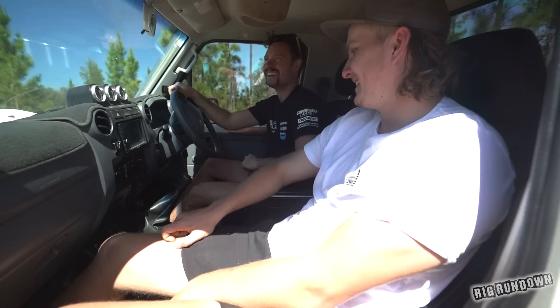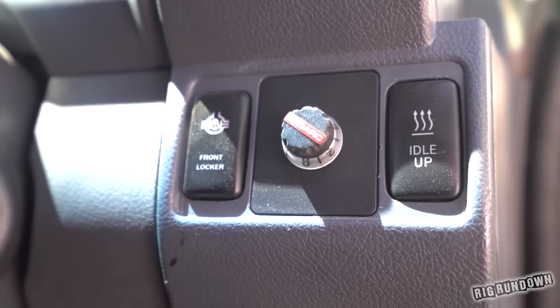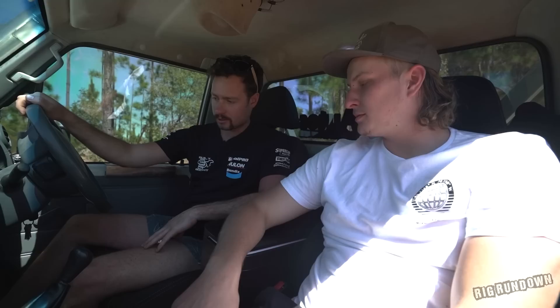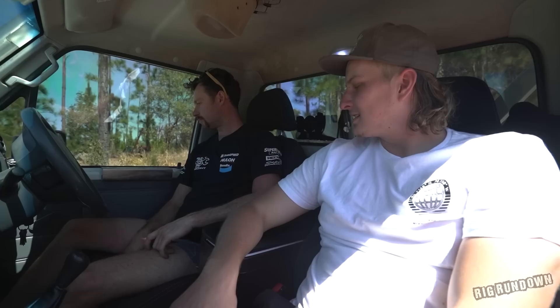There's no UHF radio in here yet — I'm waiting for a new one to come. You've done the whole Cape with a handheld! There's a Tow Pro — obviously that's for tiny trailers — and Cruise Control. There's another little switch here — what's the idea behind that? I've got six different tunes in it: standard power, towing, all sorts of stuff. Handy. Locker buttons — so the rear is a Detroit locker, like an LSD but automatic/manual with springs and worm gear teeth — it's a lot more complex than a simple clutch. And the front's an e-locker — Harrop e-locker.